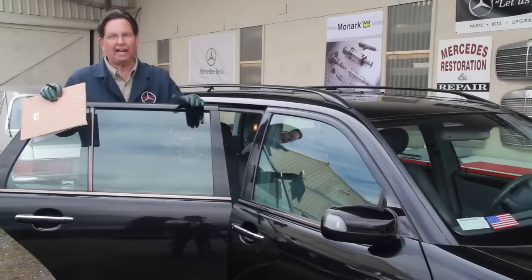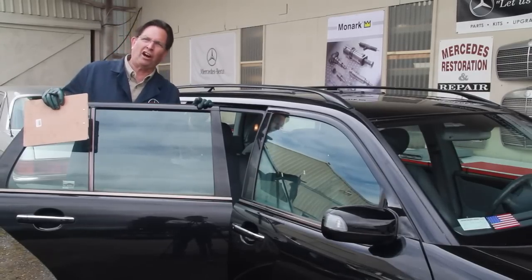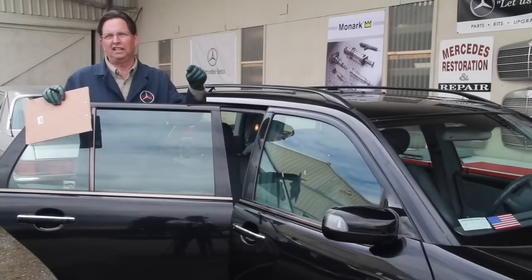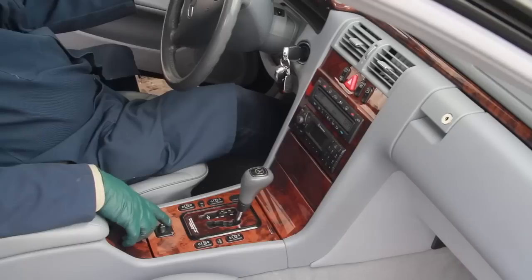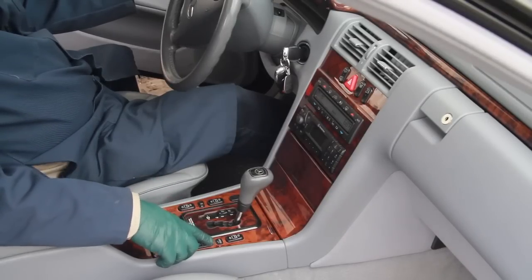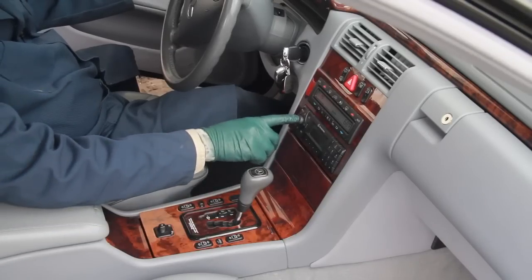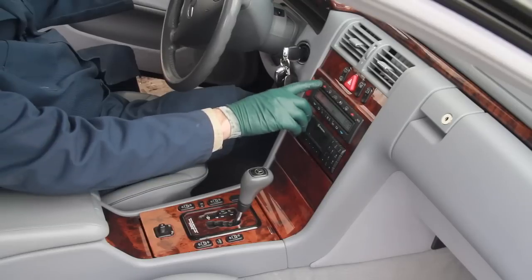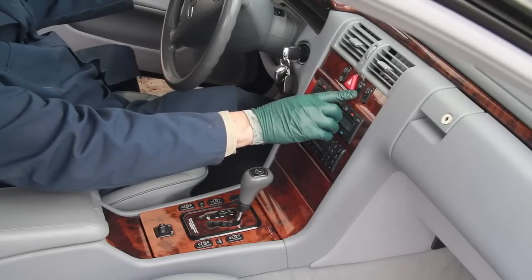Like when I got into this E320 wagon and started checking, you sit in the driver's seat. If you have to, get the owner's manual out and start figuring out how to check all the power windows, all the power mirrors, the climate control, make sure the air conditioning is working, make sure all the lights are working, on and on it goes. Now, this could be the longest part of this 5-part check, and you haven't even done a road trip yet.